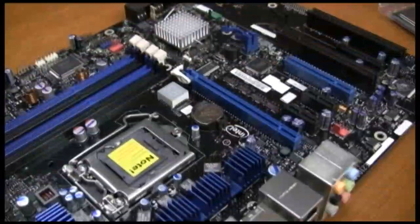Tell me a little bit about this new architecture. I know that a lot of stuff is built into the chip instead of being on the board — there is no North Bridge present in any of these boards. How does the new system work? Where did it move everything to as far as memory controllers and all that stuff? So we went from a three-chip solution — North Bridge, South Bridge, and CPU — down to a two-chip. The CPU remains, of course, but we now have something called the PCH, or the Platform Controller Hub, and that's your P55 Express chipset.